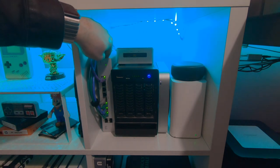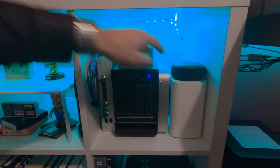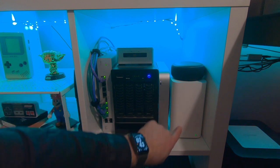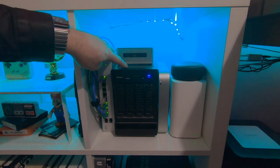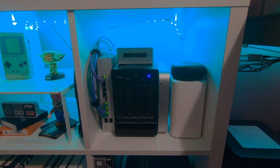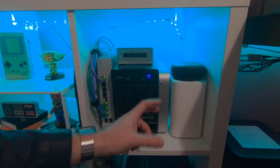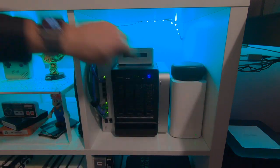I've got my Cisco switch — this is a Cisco Meraki switch with a number of ethernet cables. These are running into the devices here, as well as a spare cable running to the other side of my room, and that is also running into my core wireless network. This has been hosted via an Apple AirPort Extreme, which itself has a number of ethernet ports on the back. Every room of my house has ethernet ports. This is not my modem, just a Wi-Fi router with a WAN port connected into a port on my wall that runs into my garage, where I have my actual fiber internet coming in off the street, connected to another router and my patch panel, which connects to all of my ports across my house.